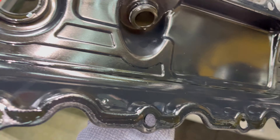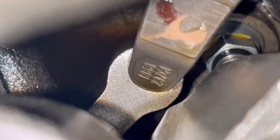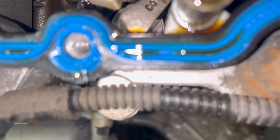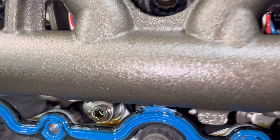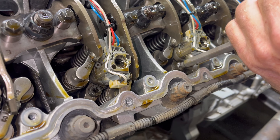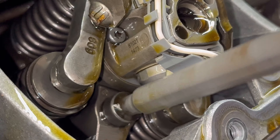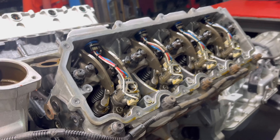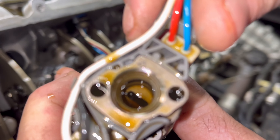Not under the valve covers — valve cover looks wonderful, not anything stuck to it. Well, there probably is minuscule stuff, but you'll be able to tell down there, those little puddles that accumulate in the bottom of the cylinder head. Driver's side — if you remember Ron's, they had the rockers all messed up. See how that goes all the way out? It's tight but it does fit, so hopefully he just had those rockers all kinds of crooked. They all just come out like that. Just look closely, see any metal on it.